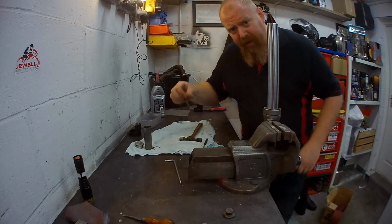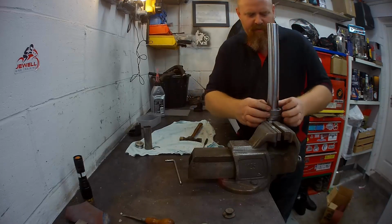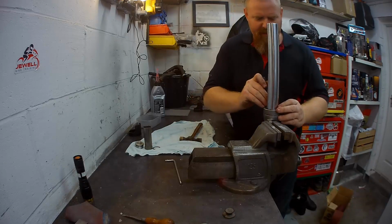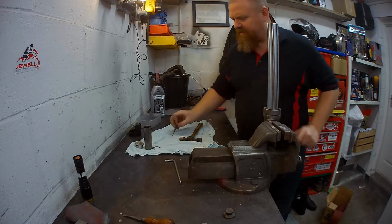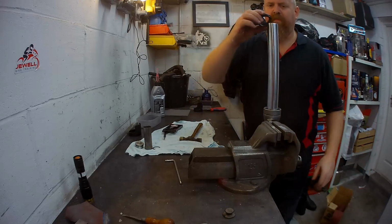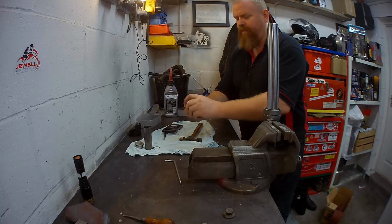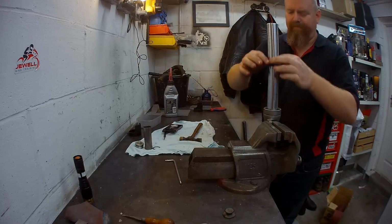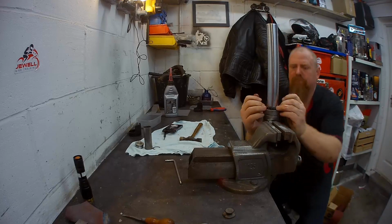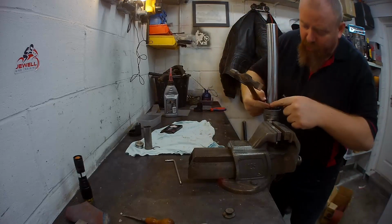Until you expose the lock ring groove, get that one in, just push that one in with the old fingers, push, listen to it snap in, nice, and the dust seal, you can lube that one up as well if you want to. Lube, lube. Squeeze. Squeeze. And then, again, should have a dolly around the outside.